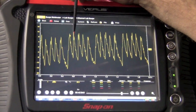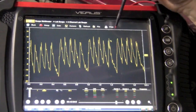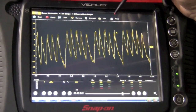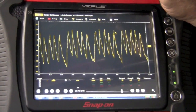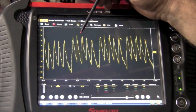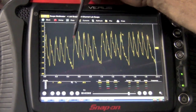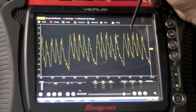Counting through the cylinders — one, two, three, four, five, six — the dropout appears consistently at the same position each cycle. By doing this relative compression check, you do not have to get access to the spark plugs and take them out. You're doing it electronically with a lab scope and you can see that you have at least one cylinder not contributing to compression — just like in all compression checks where you put a gauge in each cylinder and compare, but done electronically and relatively.